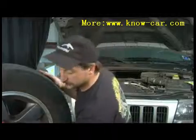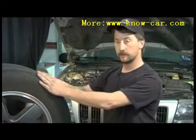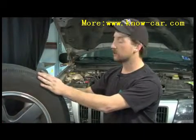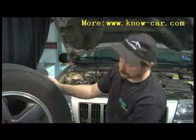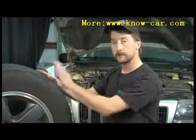Then all you've got to do is just fill it back up with air, spray a little water on the outside of where you have your cork. Just check and make sure you don't have any air bubbles or water bubbles that leak. Fill it back up and make sure you've got thirty-five pounds of pressure on it. As long as that's where it says right on the side of your tire — it's always marked there, your air pressure recommended. Fill it up, put it back on your tire, you're good to go.